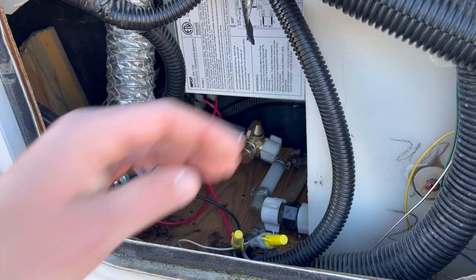We don't have any leaks anymore. I'd recommend hand tightening that and not using Teflon tape. Also, the little rubber washer inside had gotten messed up — I think I over-tightened it. This does fix the issue of water running into the fresh water tank, so if you're experiencing that definitely check that coupler. Also, if you want to install the bypass valve to winterize your RV, that's how you do it — two birds with one stone. Hopefully that was helpful — catch you guys on the next one, peace.